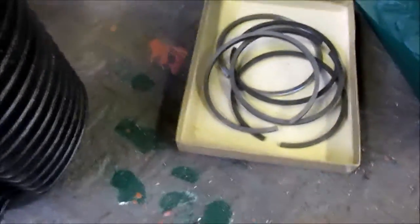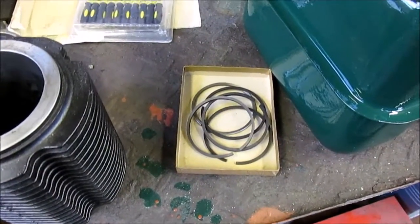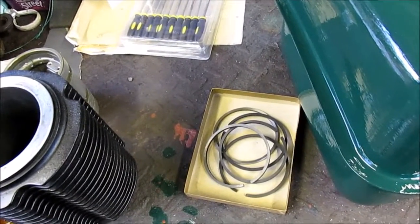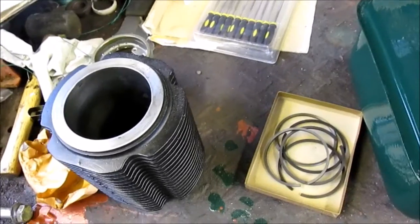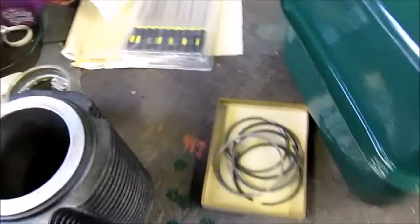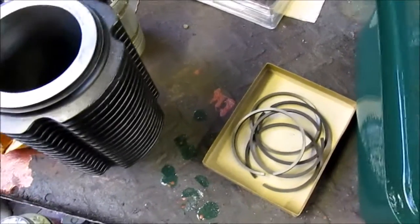I've gapped the rings - I know it looks like a messy pile. They're all about 10 thousandths of an inch; the biggest was 11 and the smallest was about 9, so they're all within a reasonable gap. I checked the bore at the top, middle, and bottom and it's consistent - 10 thou all the way through. So the bore is not too bad at all. Right at the top 10 thou, right at the bottom 10 thou, in the middle 10 thou - that's ideal really.